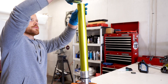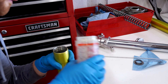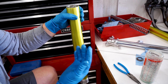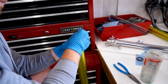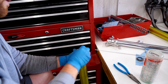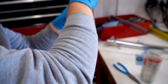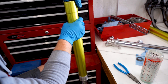With the fork compressed all the way down, make sure the damper rod is all the way topped off. Then pump the damper rod and the outer tube about 8 to 10 times pretty slow. This will be the remaining 8.5 ounces that we didn't add earlier - just pour this right into the outer tube. Pull up the outer tube as you fill it up so that way you don't overflow it. Now we're going to repeat the same process - compress the fork 8 to 10 times to bleed out that air. Just go nice and slow, compress it all the way to the bottom - you're going to hear some bubbles coming out. Push that rod all the way in and then pull it back out and repeat. That's feeling pretty solid.